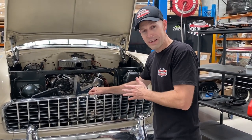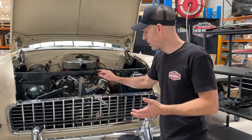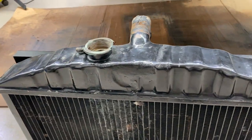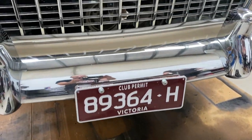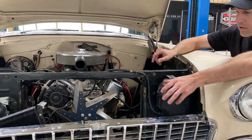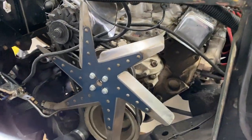So the radiator — this car has always had overheating problems. We've totally sorted out the cooling system. We've ordered a water pump, we'll sort out the thermostat, new hoses, new radiator. The old one is 10 years old, it's been repaired, it's blocked, all sorts of things. We need to get our hands on a radiator, put that in, plumb that up, get the thermostat working right and get rid of that ridiculous flex fan that rings barks me every time I get in the engine bay.